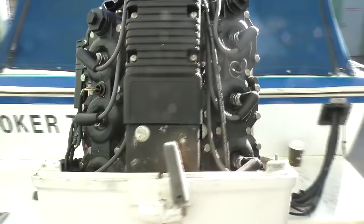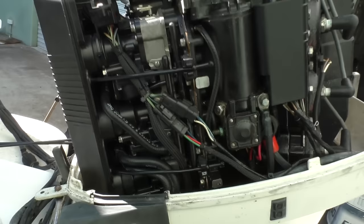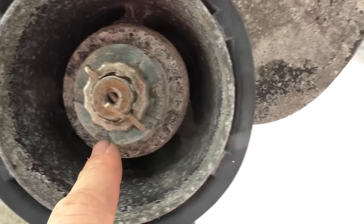First indications are pretty good. It certainly looks pretty tidy under the cowling — no obvious corrosion problems or anything. I'm just used to river boats that are always corroded, but this looks pretty good to me. I have noticed though the washer spacer behind the prop nut has been tightened and it looks like it's fractured in about three places. So I'll definitely order one of those and we'll replace that.